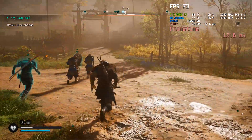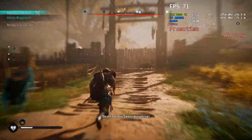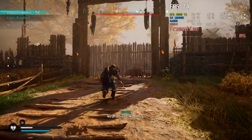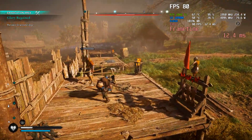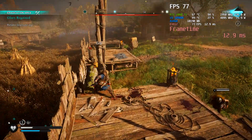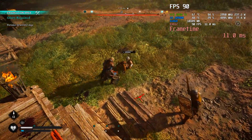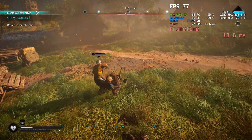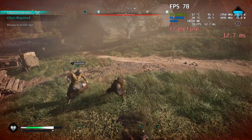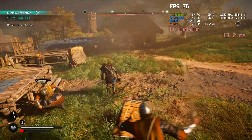The answer is that it cannot. What makes me say it can't cool it is that my spikes — like I was hitting Nvidia ShadowPlay to record, and I would hit record and it would spike up to like 85 degrees. That's the max I'd be comfortable with it spiking to. But by the time I got to the third game, I would hit record and it would spike up to like 92 degrees. And I was like, yeah, this ain't gonna work. I'm just gonna burn this chip out. I need to get a better cooler.